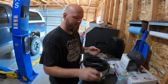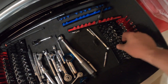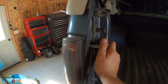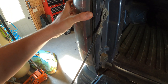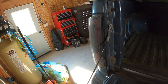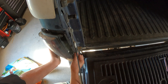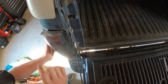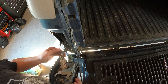To get this tail lamp out, it looks like it's just a couple of eight-millimeter bolts. I was right — eight millimeter. Both bolts are off. I'm assuming this is going to be pressure-held in, and I've broken a few of these in the past in different vehicles because I didn't know which way to pull — typically they pull straight back. Turned out it's actually at about a 45-degree angle. That said, I didn't break anything.